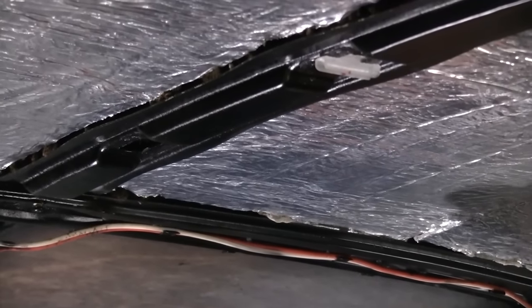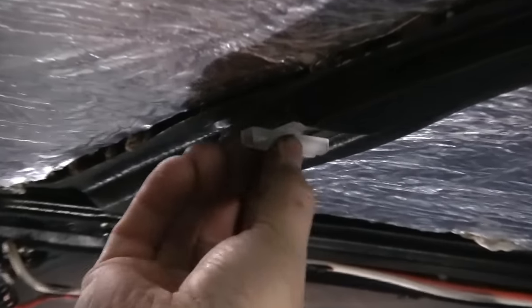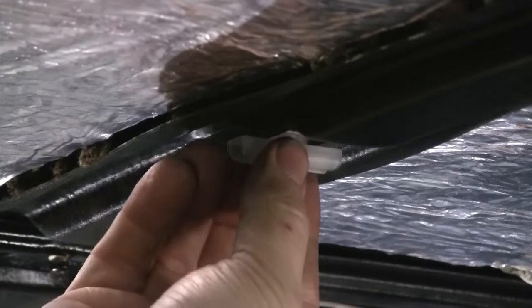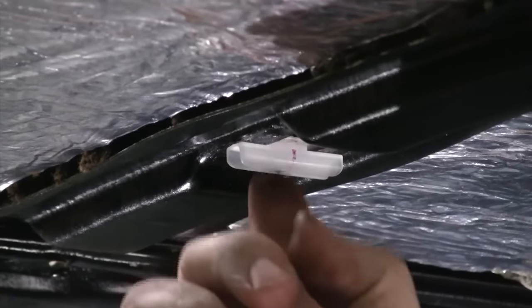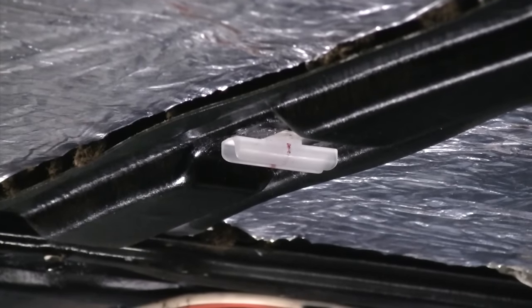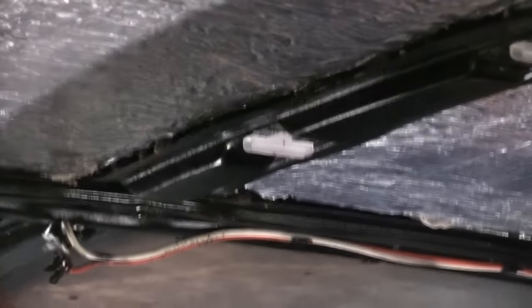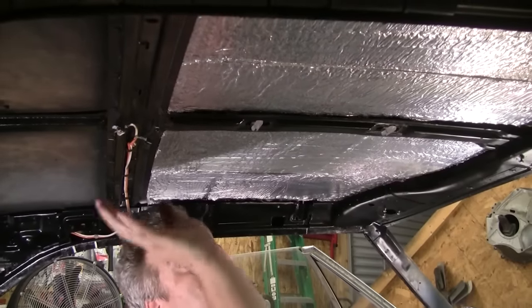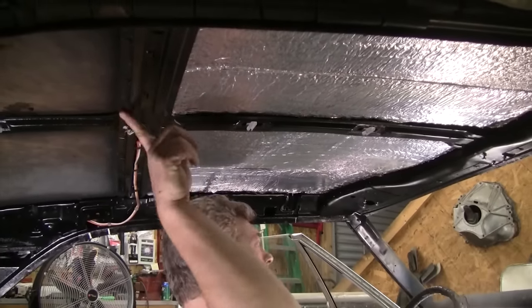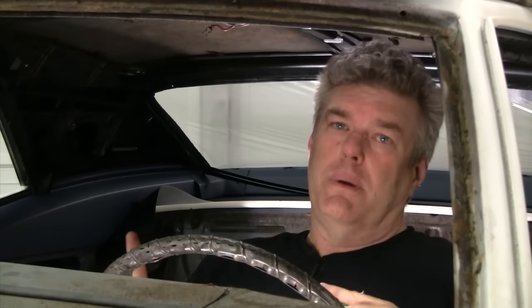Now I've got all the rest of my bow clips in and I'm going to install this one here. These need to be very mobile, so I put some Super Lube on them — it's honestly called Super Lube. You'll notice I've got red lines on both sides of the clip on all of these going out to the back. I did this with a Sharpie marker just so I know where center is when we start putting the headliner in. I've also removed the tack strip from the back. There's a bow that actually sits on these. When we start installing it, we start at the back position. So this is all in and ready to go. The next thing is to jump up on top of the car and talk about centering the headliner before you install it.